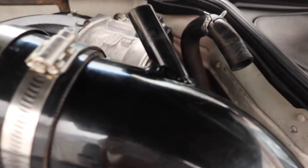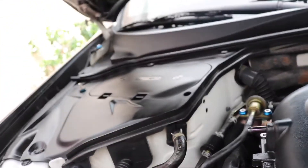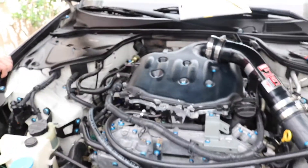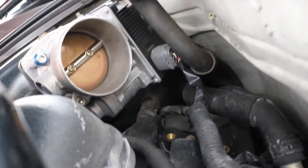So it's been about 10 minutes and we've been removing the bolts — I'm sweating because it's been hot as hell. I've removed the intake from the throttle body and had to remove this hose that goes toward the battery. We're moving that little hose right there that connects to the plenum, and then we're gonna try to remove this sensor that connects to the throttle body.